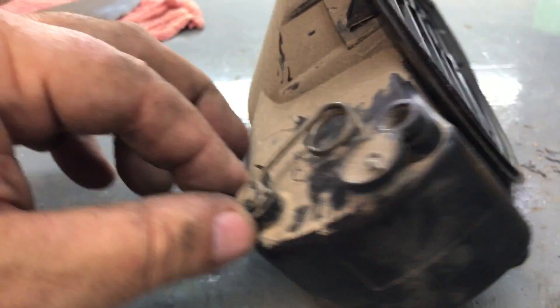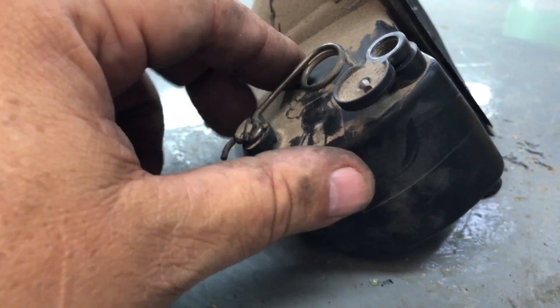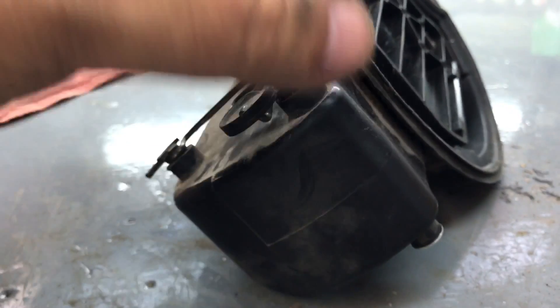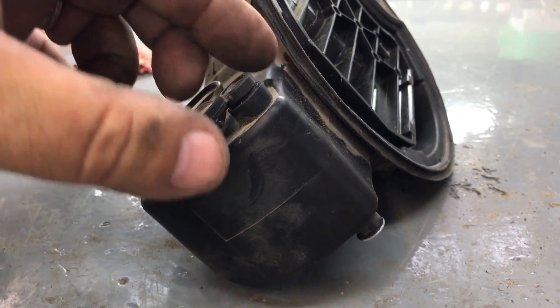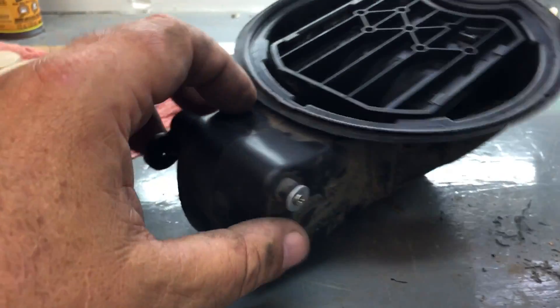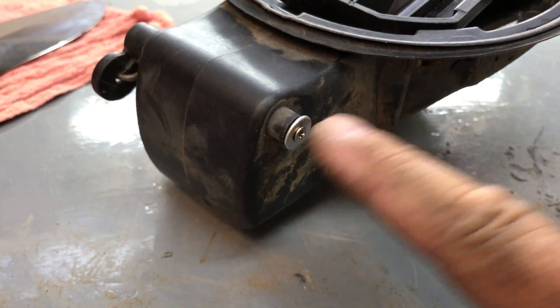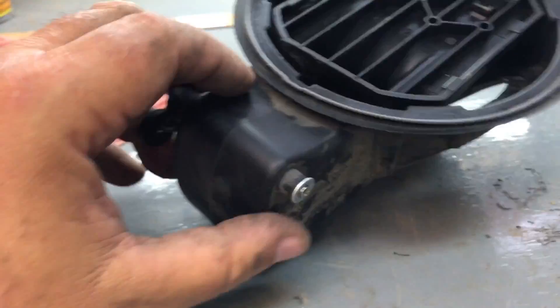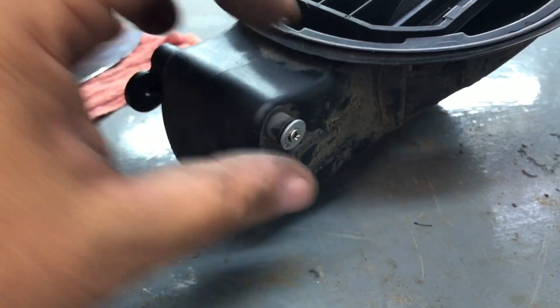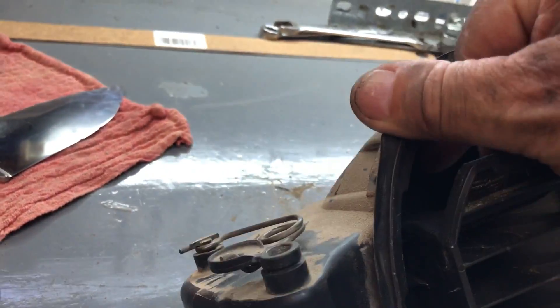What I did was pull the whole pin out, take the spring off — it just pops right off, you pull it towards you and it'll pop off the post, then it wiggles out. Pull the whole pin out; it takes a little effort, you've got to pull pretty hard. I drilled the pin — I started with a 1/16th-inch bit, then went to a 5/32nd bit. Then I put the pin back in and used a screw and a number 8 washer to hold the pin in. Now it works, and we're going to go put it back in the truck.